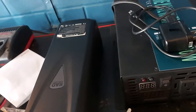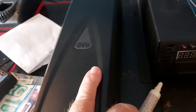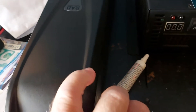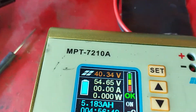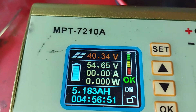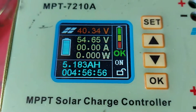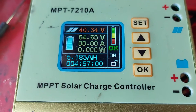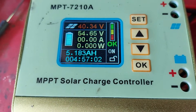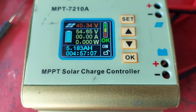When you turn it off, it starts charging through the BMS. It charges through the BMS, and when you start charging through the BMS, it shuts it off. The RAD battery BMS shuts down charging at 53.7, 53.8 — right about there.